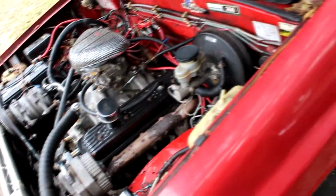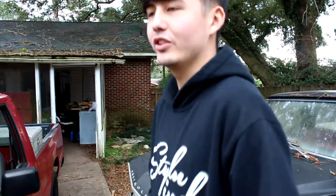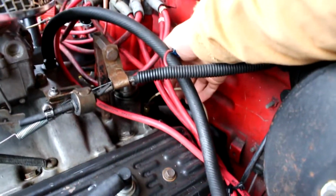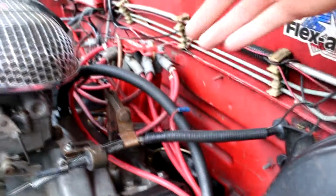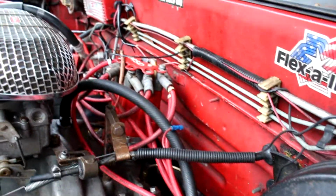But what I did, yeah, you told me. Just saying. What'd you tell me, Dean? Told you before I left that it's a mechanical oil gauge, so it has live oil feeding into it, so there's a line, and make sure you bolt it back up before you start the truck up or a geyser comes out. Why don't you take a breath when you talk? Nope. I forgot to bolt in this line, which is the oil pressure line. So, man, it shot up out of like a cannon. I thought I destroyed the engine or something.